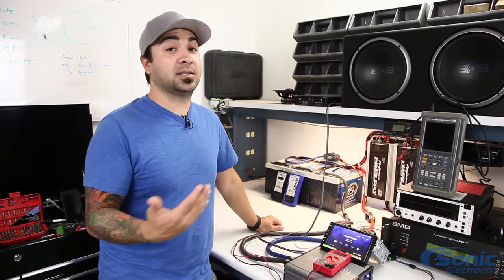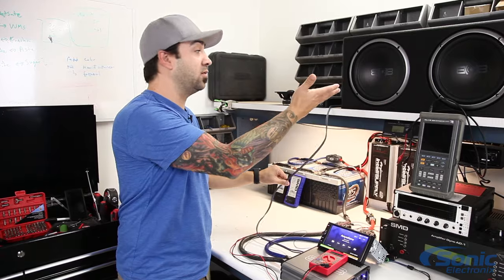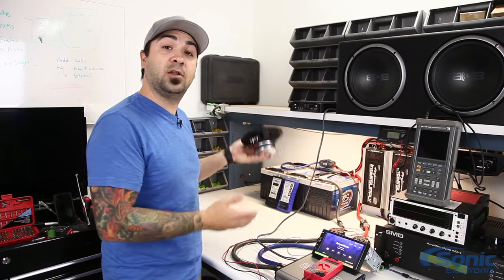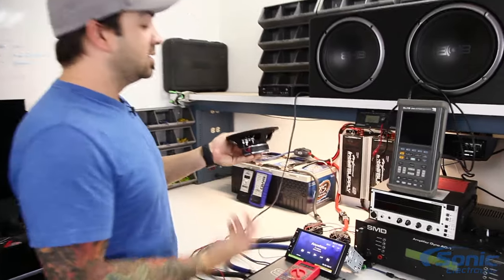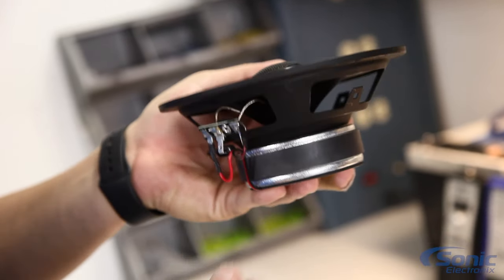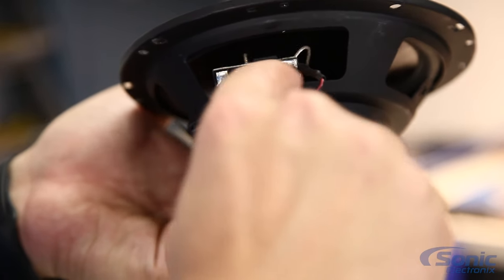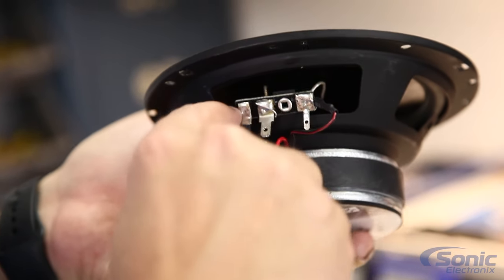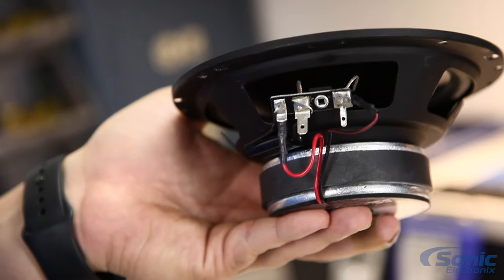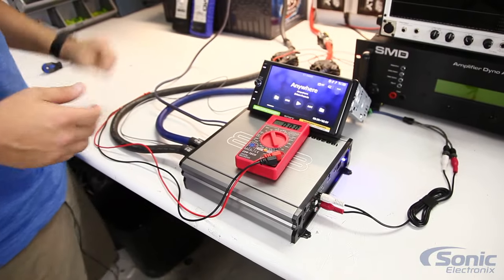Now you know you can go back and check your ground. Another problem, though less common, would be something shorted in the speaker wire running to your subwoofer box or door speakers. When you install speakers and use soldered or crimp terminals, those terminals have the possibility of shorting out in the door — touching metal — which would send the amplifier into protection, or depending on the sensitivity of the protection circuit it might still play but then shut off.